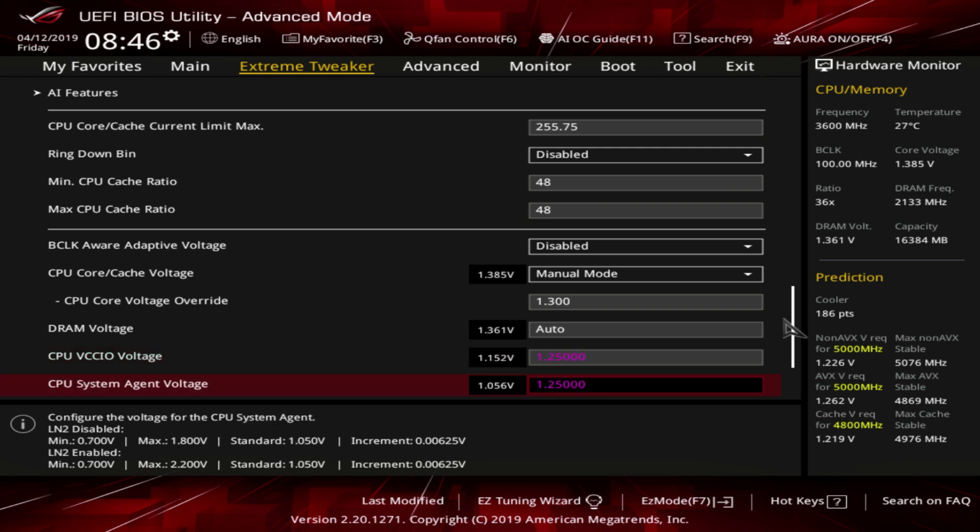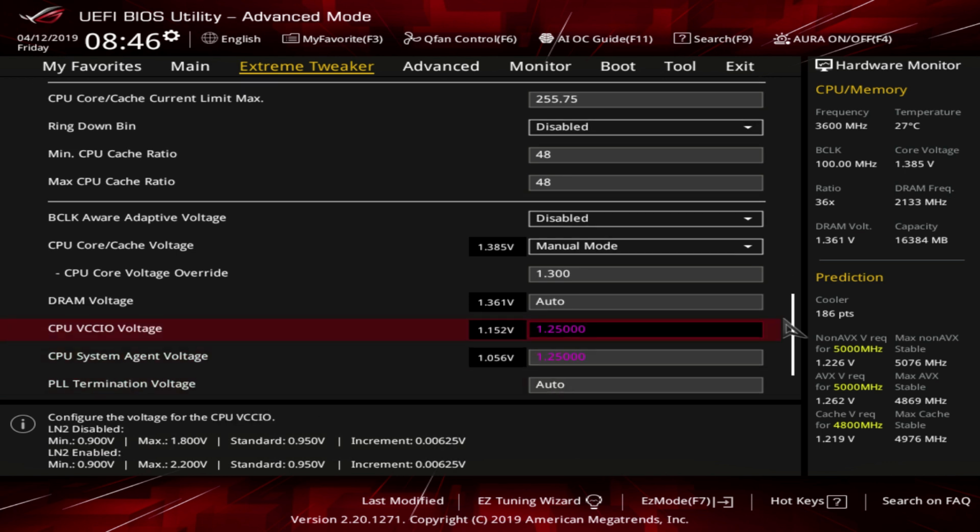Basically, you don't have to crank them up super high unless you're doing some ridiculous memory settings. And for day-to-day usage, you really shouldn't be going over 1.35 for either of them. They do potentially have a sweet spot, so that is something to keep in mind. You might have to dial them in a bit. But a lot of the time, more is just better with these. Like a lot of the time, if you can't even post, raising them tends to help.